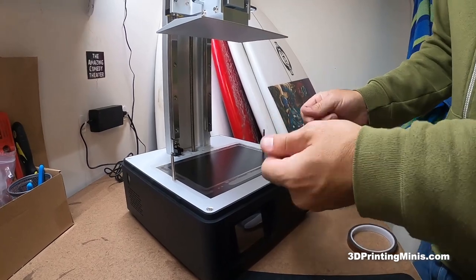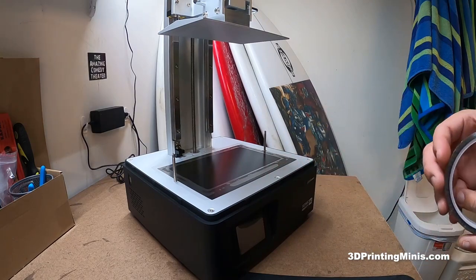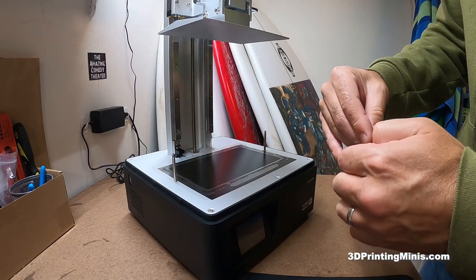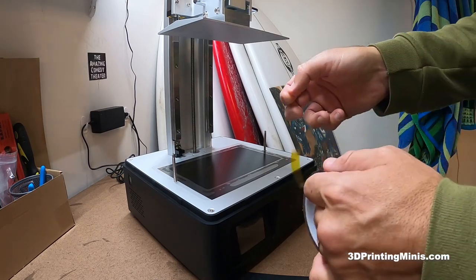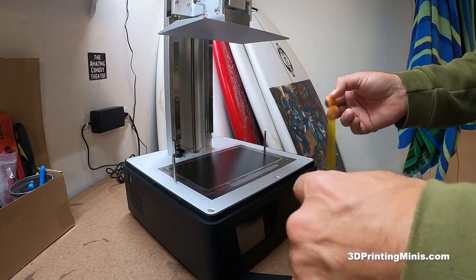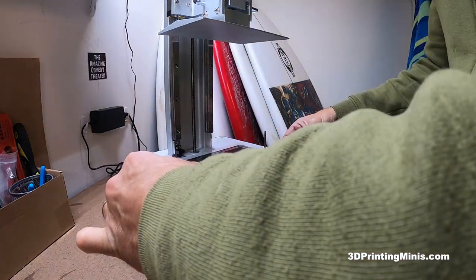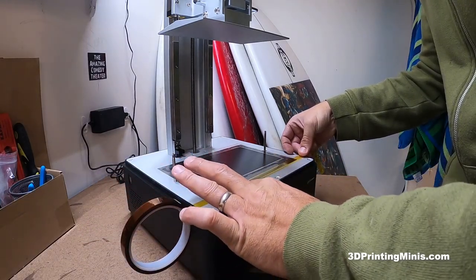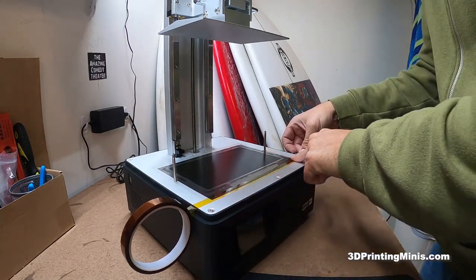I'm going to cut the ends off to remove the part touched by my finger oils. See this tape's very thin — it's not really metallic but it's thin and high heat, that's why you use it. There's junk on the first few inches so we're going past that. We just bring it across, start at one end, line it up, run your finger across very gently and gingerly — boom, perfect. Seal it down and give a little push.